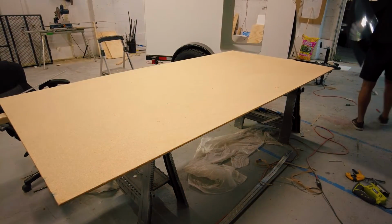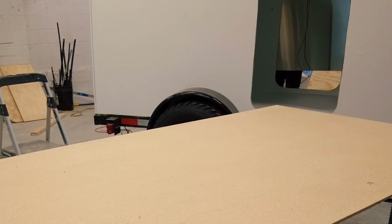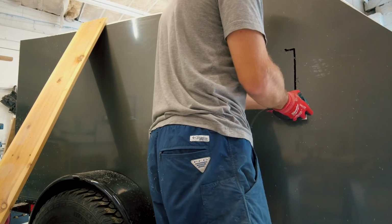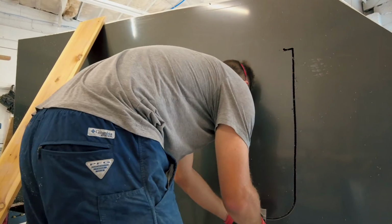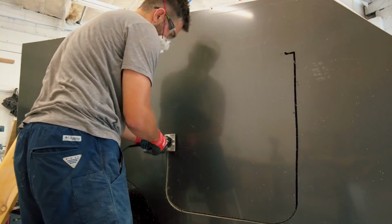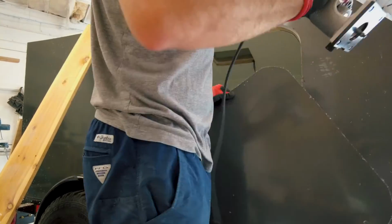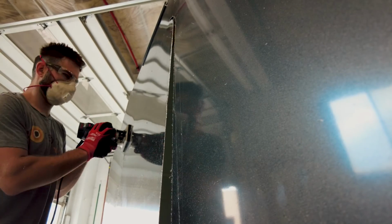Once the sheets are mounted onto the camper, I use my router with a flush trim bit to cut out my doors and vents. This makes a huge mess with the aluminum, but it is fast and it is very precise. I highly suggest using a mask and glasses when doing this. Aluminum dust can wreak havoc on the respiratory system and has even been linked to brain disease. Be careful and always use your protective equipment.